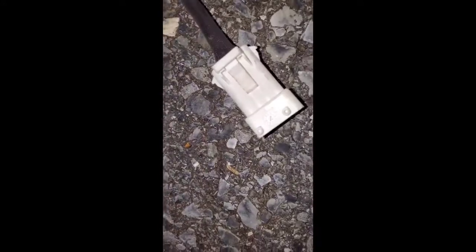Alright, I said I wasn't going to record me putting it back on, but I think I might, just for the heck of it. Alright, so how I'm going to start is, I'm going to just start by hand screwing this on there. Once I get it in position, don't put this plug back into position until after you got it screwed in, because you know the belt's gonna be twisting while you're tightening it.